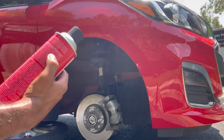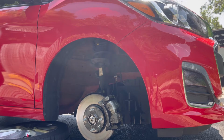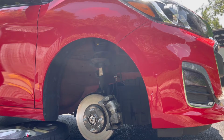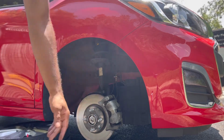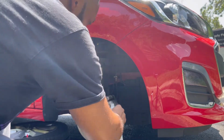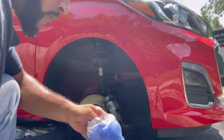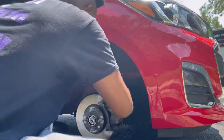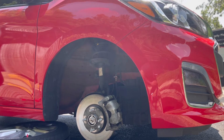First, I'm gonna start with the brake cleaner. Okay, hit it with the brake cleaner, let that dry a little bit. Then my soapy water, I'm gonna use that, wipe it down, let that dry, so make sure your surface is nice and clean. I guess no need to really sand it. Like I said, the car's pretty much brand new, got it last year, 2021, so it's not really in any rust or anything, so painting over should be good. Soapy water, spray it on there. Microfiber, wipe it down, let it dry, it should be A1. Okay, back drum. Okay, now they're all wiped down and clean.